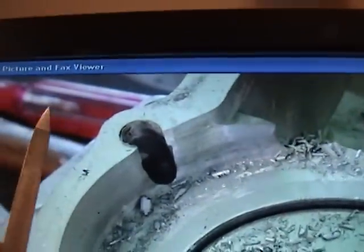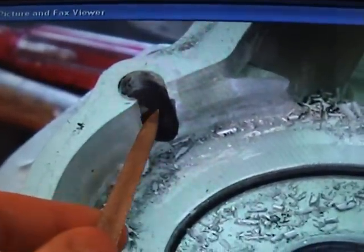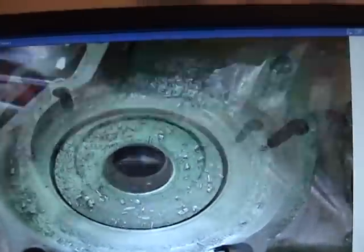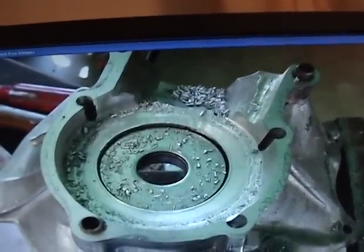Now on the holes up here, these are not going to hurt anything as long as your case integrity around the edges is good. No air leaks can come out of here, here, here, here, or through the holes. Okay, you can have the vacuum inside here, but air cannot leak out of that channel. Therefore, once you put your bolts in, you need to seal the bolts on either end in order for you not to have an air leak.